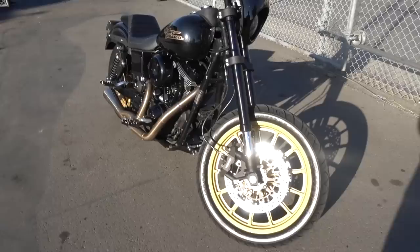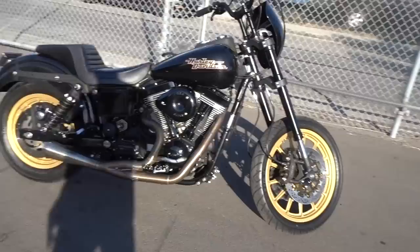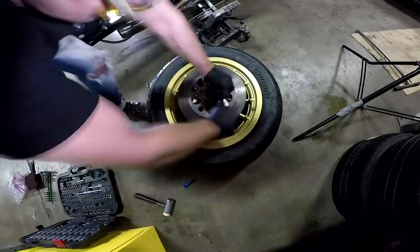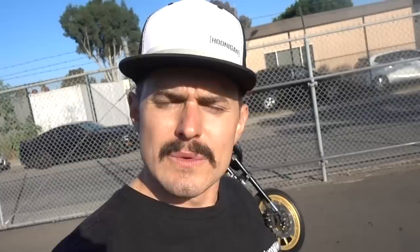Got her all finished up and got a couple of test rides in. After shaking it down, I have to say this is such a massive difference — I never thought this bike would actually be able to stop or handle. It's nimble around turns, nimble at slow speeds, and you can maneuver it through traffic a hell of a lot better. The hardest part had nothing to do with the front end — it was getting the proper spacing on the rear wheel, and the first rotor I installed was actually warped, but luckily I had a spare. One of the big things that stood out was the weight: my old forks and triple trees alone were 19 pounds heavier than these new forks with the brakes, rotors, all the lines, and all the hardware. That's a massive difference and you can really feel it. It's night and day. Super happy with it.